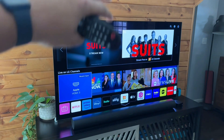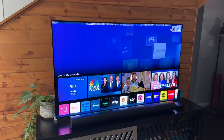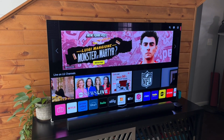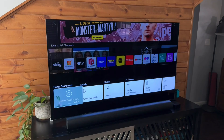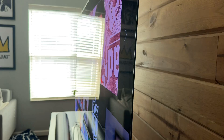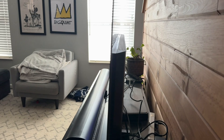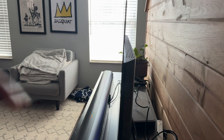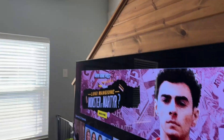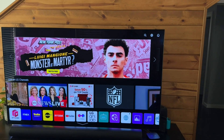Now with Wi-Fi and anything tech, there could be so many different issues as to why we're having these Wi-Fi connection issues, and I'll give you some of the main reasons. I did a video before this on the Samsung TV and a lot of people were saying that a simple soft reset was able to help them get their Wi-Fi back in order. A soft reset is really just unplugging the TV, and once it's unplugged, leave it unplugged for like a minute — longer if possible — and let all that electricity that's built up in the TV dissipate, and then it will help the TV run smoother. So many times it was that simple to solve your Wi-Fi issues.